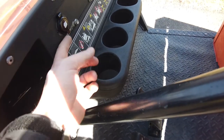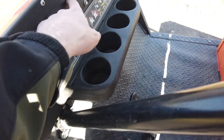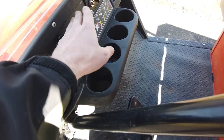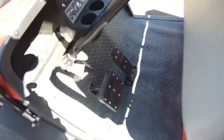It's pretty simple though. It's a 12 volt outlet. You can buy them anywhere, and I'll put a link in the description for all this stuff. But in a lot of these golf carts, there's already the wiring for a 12 volt outlet behind there. So it was back there. I just had to run some extensions, make sure polarity's right, positive, negative, good to go. That's easy. So we'll show you some of that in a minute.